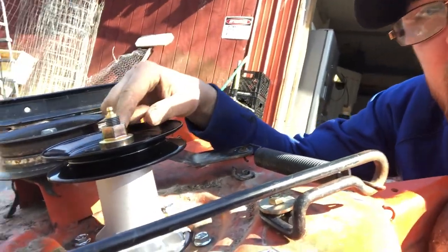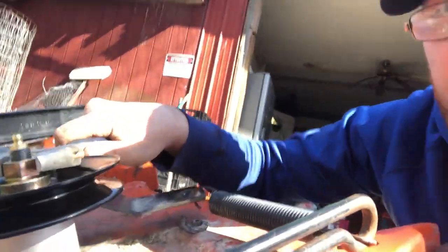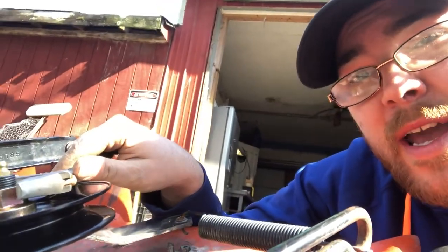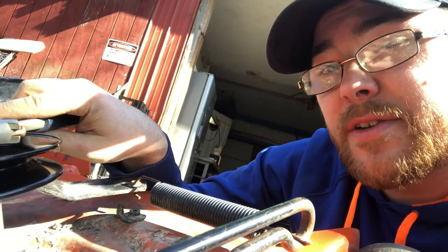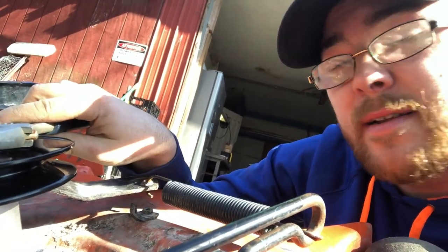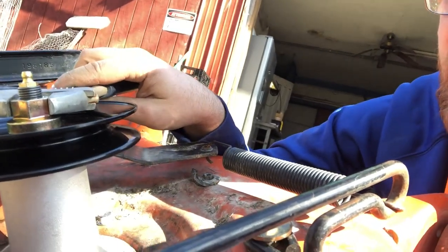That's that, times three. One thing I did forget to mention, because you'll be wondering how it fits. As you can see, this is a pass-through nut, so the threads are gonna start coming out the top. And it doesn't take much to get it screwed down. So all I did is literally just hold the adjustable wrench in place around the nut. I did all the work with my other hand, just turning the blade underneath. So you finger tighten it till you can't anymore, and then just spin the blade. As long as you're holding this in place, it takes a little effort, but it's pretty easy. And it'll tighten all the way down.